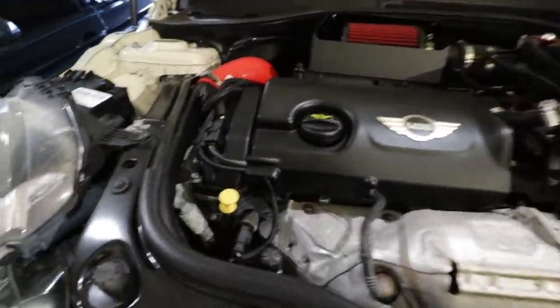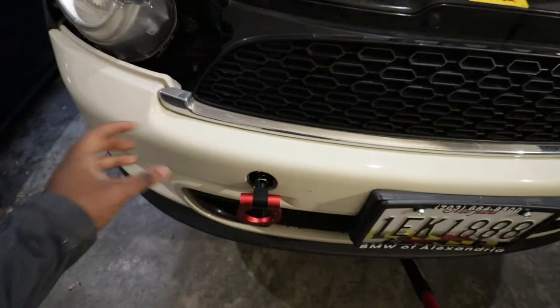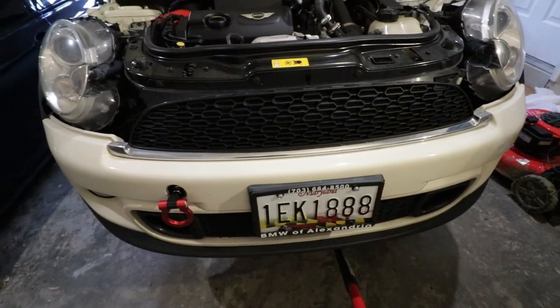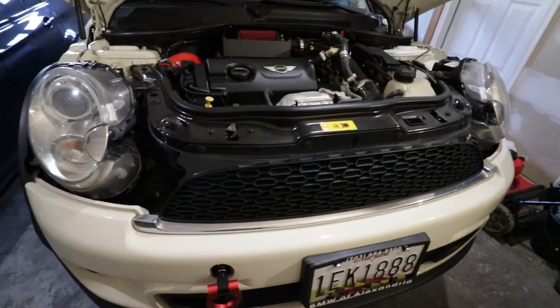So why do you need to upgrade the intercooler? Well, the intercooler on the Mini Cooper is quite small — it actually acts like a bottleneck on the whole cooling system. Upgrading it is going to help with engine temperature, and since I'm planning to tune my car, it will provide better cooling compared to what is in here right now. So let's go ahead and start the process. This is fairly simple — all we have to do is remove this, remove the bumper, and then swap the intercooler itself.